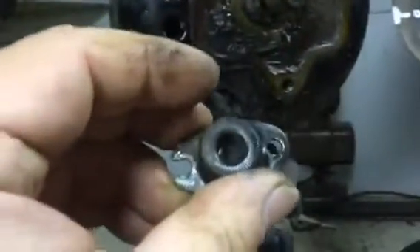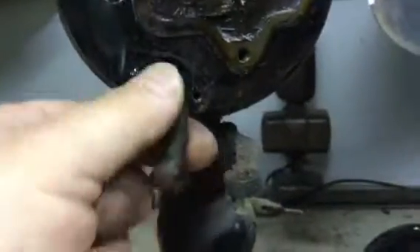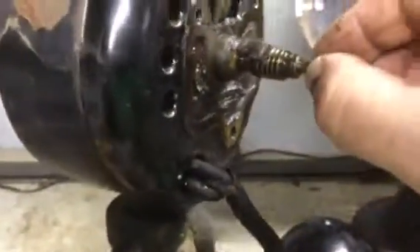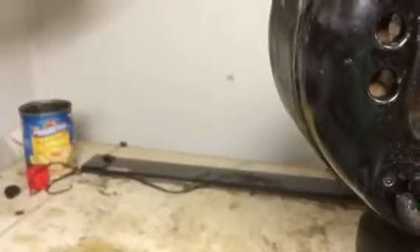I just sort of twist and pull, and there's the bushing plate back off. There are the connections going to the motor — don't pull on it; there's a space where those are folded up inside. Now here is the drive shaft for the worm and the worm screw that runs the oscillator. There's a nut right here that has a backwards thread that we're going to want to remove.